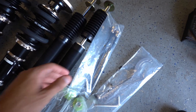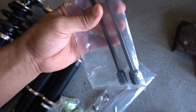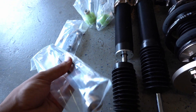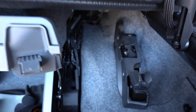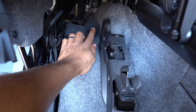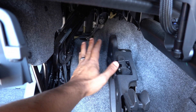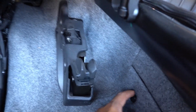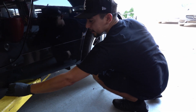As far as adjustable dampening, it's really hard on the E93 convertible to get to the back struts, so I ended up paying about forty dollars to get these extenders. That way if I ever need to adjust the dampening settings, I don't have to remove all the liner from the back of the trunk. Normally you would have to take all of this out just to get to the knob, but with the extenders we can route them out through the side here so you can adjust it much easier.